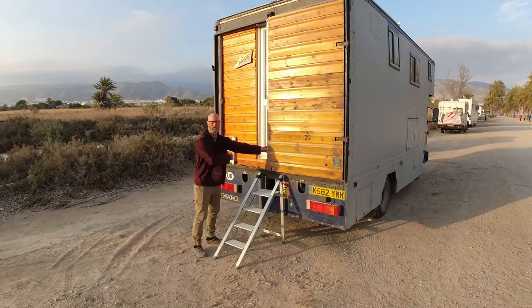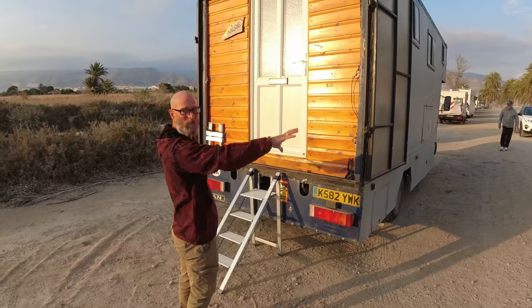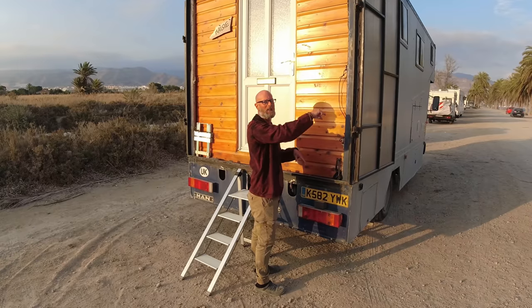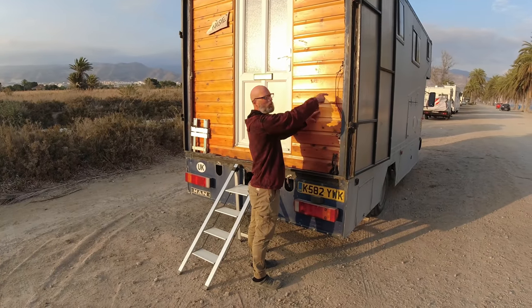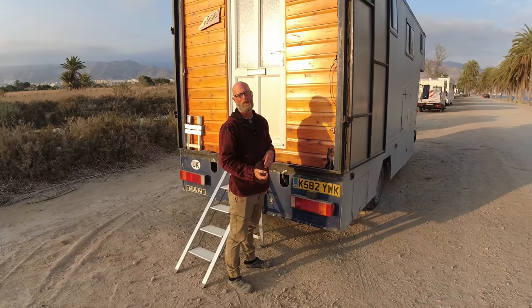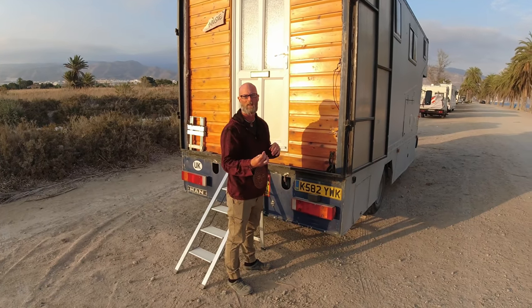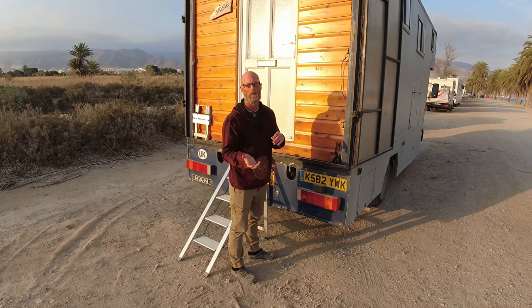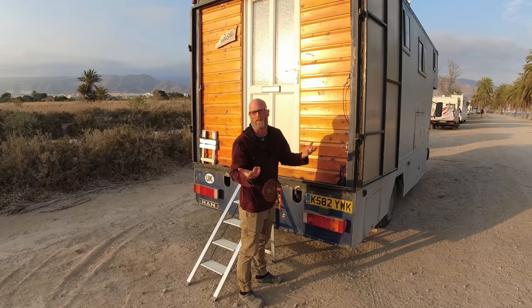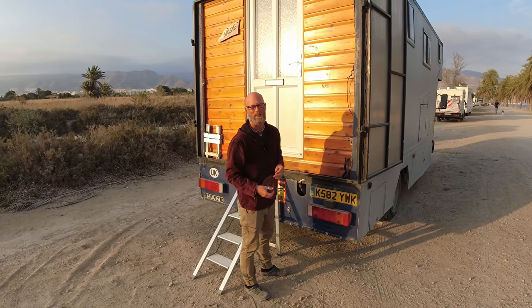The other door just pulls across and they bolt from the inside. Effectively we got the truck, stripped it all out, then made wooden battens and built that sort of inside the truck — a standalone, independent-ish frame, occasionally bolted to the actual truck. It flexes a touch when you drive, it's not breaking anything. Where you've got panels that join where the walls meet the top, I originally filled those and it's cracked. I've tried flexible filler, tried bits of rope — hiding it is the easiest way. The door opens and shuts beautifully depending on how level the ground is; if you park too skewiff it's a bit more of a problem.